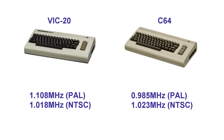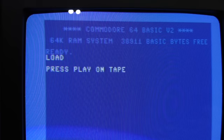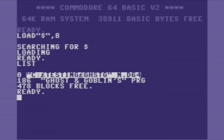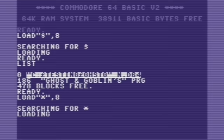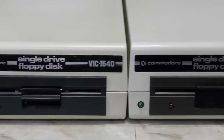Looking at the clock speeds, you can see the PAL C64 is definitely slower than the VIC-20, but the NTSC version looks a bit faster. What really isn't explained by these numbers is the effect the bad lines have. Since the CPU clock speed takes a dip every 8 scan lines, the C64 actually gets less work done than the VIC-20. And because the clock isn't running at a stable rate, it makes things like serial timing routines far more difficult. In order to maintain compatibility with the same cassette format, the C64 kernel will disable the video chip during loads, which means the CPU can run at a constant speed. However, when loading from disk, they did not implement the screen blanking feature, which means the only way to solve the problem was to make the disk drive a little bit slower. And for this, the drive was changed to the VIC-1541.